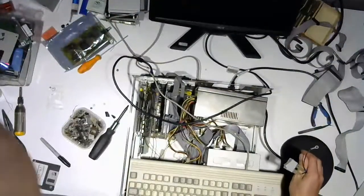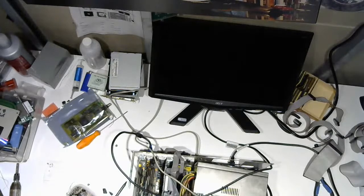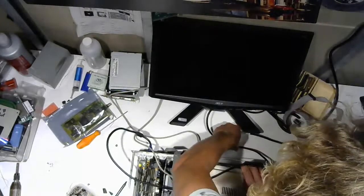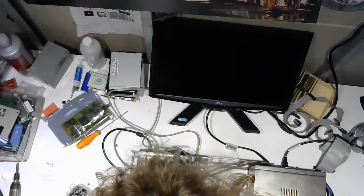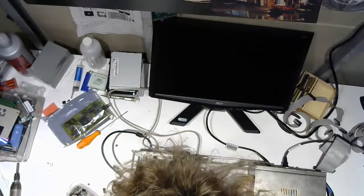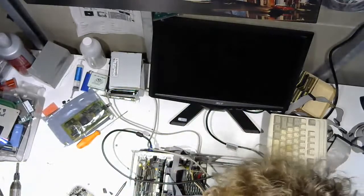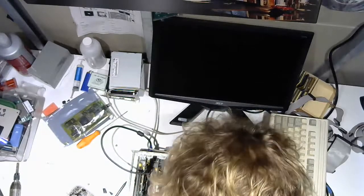Okay. We just move the camera over to the screen. And here we go. Oh, the two floppy lights are on, so something's wrong with the wiring, and we've got no POST. We're off to a fantastic start. So let's take that out. Take off the IDE. Hit power again. So now this floppy light is on, so I think what the problem is is that maybe this whole thing is backwards. Okay, let's just take that out.